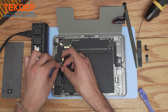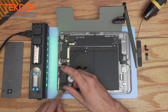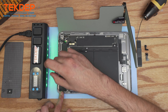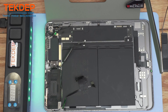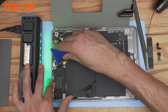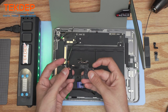There is actually a flex cable that goes all the way through here. Then we're going to remove the screws holding the top loudspeaker. This area has a lot of resistance and a lot of glue, so first take out the screws — there are also some hidden screws you want to pay attention to. It's not clear why Apple decided to put a top cover over the loudspeaker; it seems related to the cooling system because there's only copper beneath that metal bracket, making it a bit tricky to extract the top speaker.